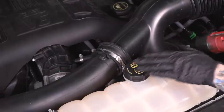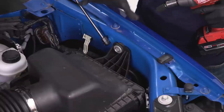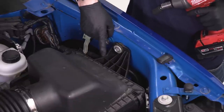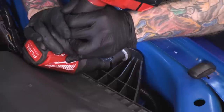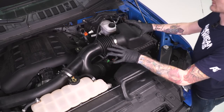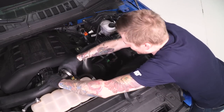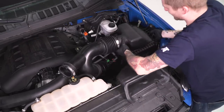Your second clamp is located on the top here just behind the coolant reservoir. We're almost ready to remove our intake as one piece. The next thing we have to do is unseat the air box from inside the fender. We're gonna remove this bolt — you'll need a 13-mil socket. All you gotta do then is pop the air box out of the rubber grommets underneath and remove the tubes where we separated those clamps. You can pull it out as one piece.